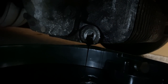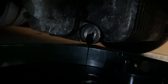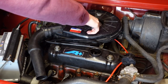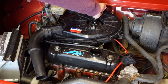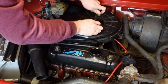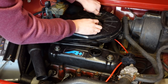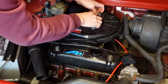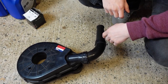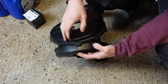While all 5.1 litres - yes really - of oil are draining from Melody's A-Series, let's turn our attention to our other two jobs for today's video. First, the air filter. The health of the air filter can be the biggest indicator as to how well a car has been maintained, and if it's caked in dirt it'll seriously scupper performance. The filter housing is held to the top of the carburettor with two wingnuts, and once they're removed the entire unit pulls off, then the two halves can be unclipped, revealing the horrors beneath.